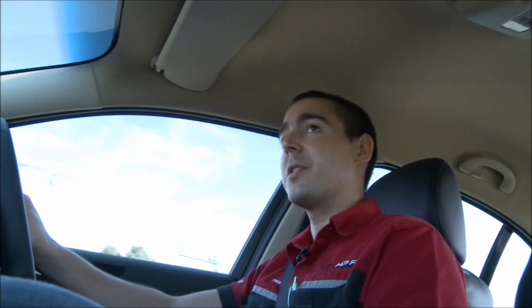I've managed to get rid of the torque reduction, so on the gear changes it doesn't reduce torque. Before, you could hear it cuts a spark and it sort of pops out the exhaust on a gear change, on a wide open throttle gear change. And we've got rid of that now, which makes it feel quite a bit faster through the gears.